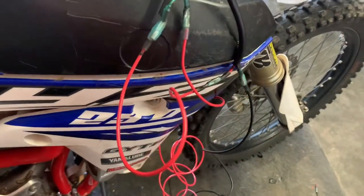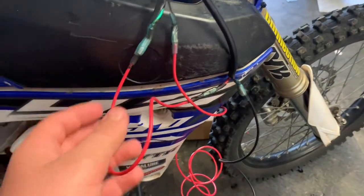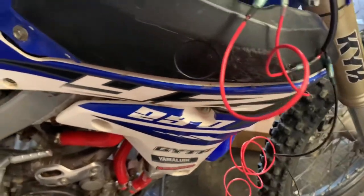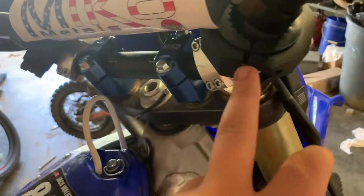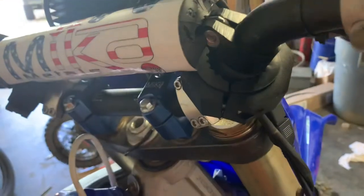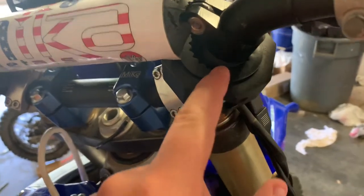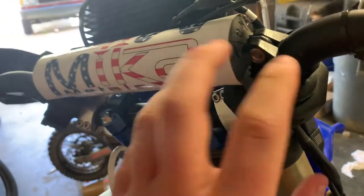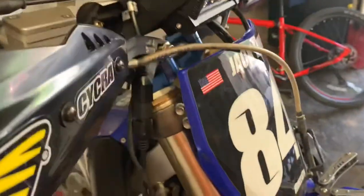The butt connectors are about twelve dollars each, and they just heat-shrink up. Make sure they're tight. The way I installed the light bar was with clamps from Tractor Supply — they're a little big and come with a small rubber circle inside. When you purchase it, wrap that around your bar and tape it together so it stays, then put the bar clamp over that to give it a bit more grip.